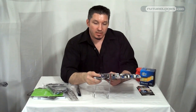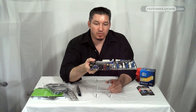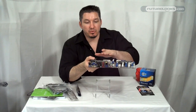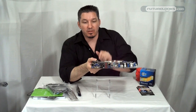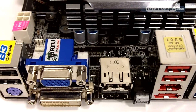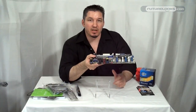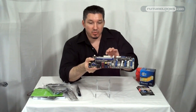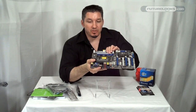Here's your video out — you don't usually see this on an ATX platform, but this is a Sandy Bridge platform and in order to access the graphics feature built into Sandy Bridge you need your video out, which is why they have the Virtu from LucidLogix. These ports are active while you have your discrete video card in — you can run both at the same time. You just use the software, which is quite easy to set up, and there's an on/off button once it's installed to access that feature.